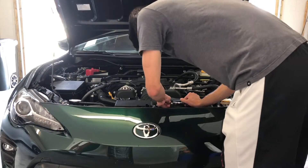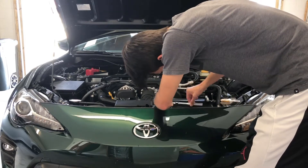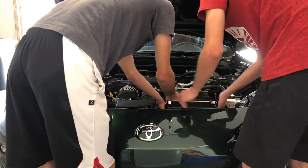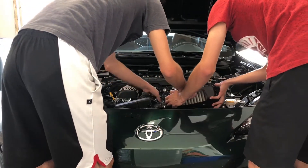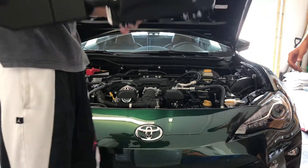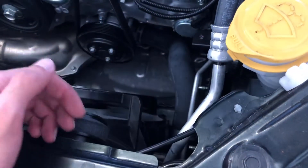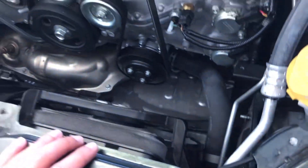The whole thing — just get rid of the clamps first and then you can move on. Also take out this sensor right here so we can put it into the new one. This is the stock air box and we're gonna be replacing it. We took the air box out, and I'm just gonna assemble the new part. You also need to take this out right here because the engine one needs another mounting point which goes right up here, and then you can use all three of those.